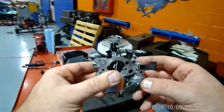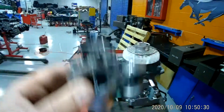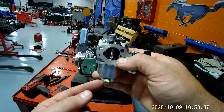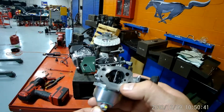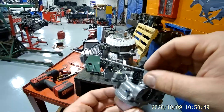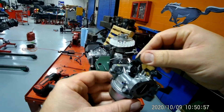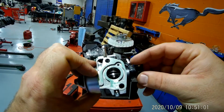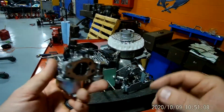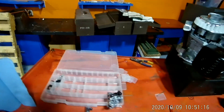Okay, here's my carburetor. If you look, it's got a couple of little screws in the bottom. This one I believe is for emptying the carburetor — so if you want to let this engine sit over the winter and you're not going to use your lawnmower, you can drain all the gas out right here. That way the gas doesn't stay in there, get funky, and clog up your carburetor. The float and such are inside of here — this is called the bowl of your carburetor. Fuel is in here with a float to help deliver fuel to the engine. This right here is called a butterfly valve, much like a throttle plate on a gasoline car.